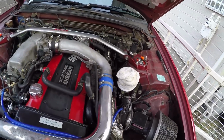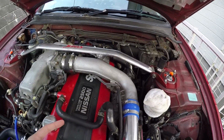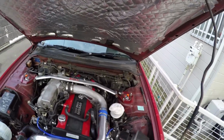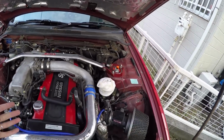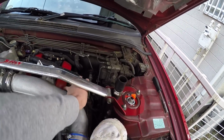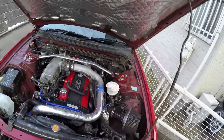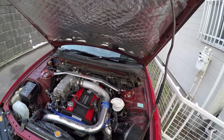And then it triggered, and I'm like, hang on, what if the air's getting in through up here and something's happened to the Coke bottle cap? And I stuck my finger in there, and sure enough, there was no Coke bottle cap. So the entire time when I would rev my engine up and the turbo would start sucking in air, it would suck a little bit of air in through this pipe that the airflow meter didn't know about, and because of that the ECU was getting confused and the engine would just stall out. So yeah, that's what was happening.